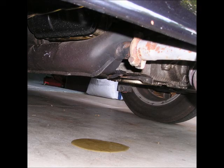If there are any leaks, it will be very easy to tell where they are coming from, either the drain plug or the oil filter. Once you have identified the leak location, go back under the car, repeating the steps of blocking the tires and safely jacking the car up, and tighten either the drain plug or the oil filter so that the leak will be stopped. After you do this, your oil change should be complete, and be sure to dispose of your waste oil in the drain pan safely.